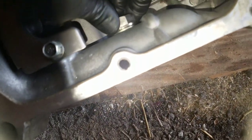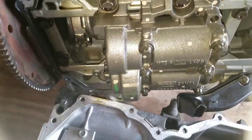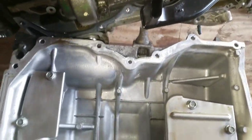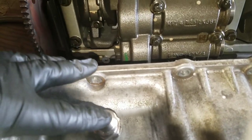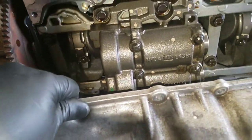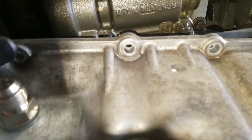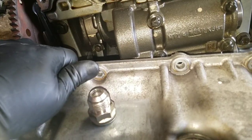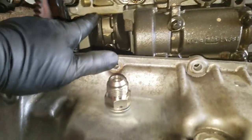It fits just like that, fits perfectly and doesn't hit anything. Hope that helps you guys. For sizes, the minimum you want is a half-inch fitting, but the best ones are five-eighths. Match up the return hose to that size. That's how I did mine on the Speed 3. I'll be putting up more videos of the build to see how it performs and holds up to boost. Any questions just let me know — please hit the like button, share, and subscribe.